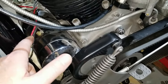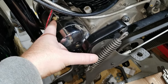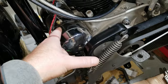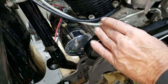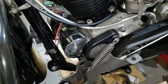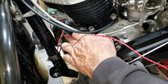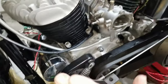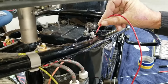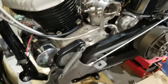We have everything hooked up and the battery reconnected. We're going to flash the generator. What we're trying to do is make it charge properly in the right direction — we want it to charge with a negative ground system, not a positive ground system. They can charge backwards and it makes it not charge correctly. To flash the coils, you always take the armature terminal to the positive terminal with everything hooked up, and you just touch and hold — it does a momentary spark.